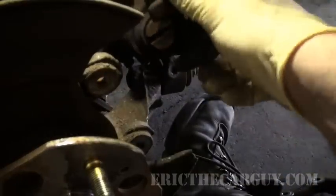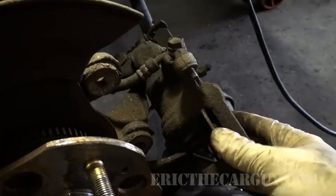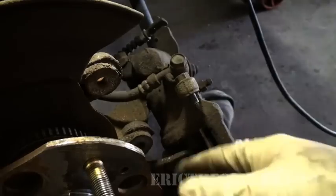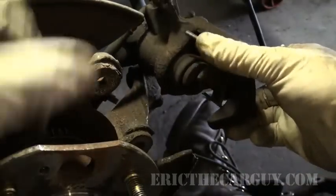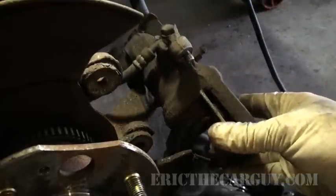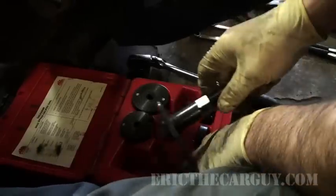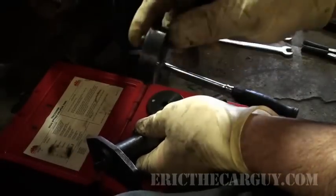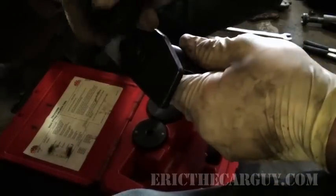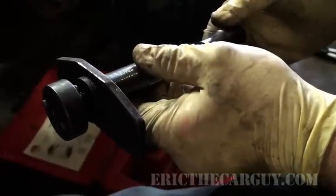I'm pretty sure this is why you're watching this video — because you need to figure out how to get this caliper piston back inside here so you can accommodate the new pads. Only on calipers where the parking brake assembly is part of the caliper itself is this a concern. Some rear discs have a drum brake setup inside, and there's no parking brake assembly out here — in that case, you can just compress the piston like you normally would for a front caliper. Well, this is a ratcheting mechanism and it needs to be turned back in. Conventionally, this tool is used — a general universal tool set with different-sized discs for turning in different types of calipers. These discs mount onto the end of the tool and you turn the caliper piston in.